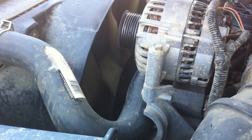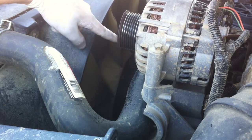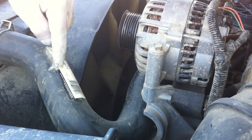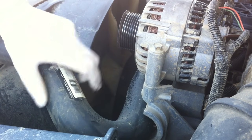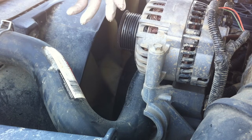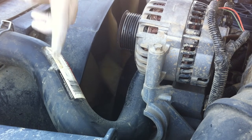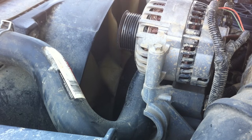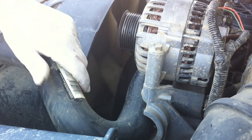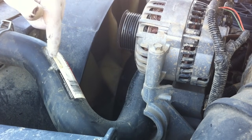On most 7.3s, the upper radiator hose is routed through the serpentine belt — instead of going around, it goes straight across. The only exception is the dual alternator 7.3s where it does have a go-around hose. This is also a great thing to do while you're doing this whole procedure, because this way you don't have to remove this hose in order to change the serpentine belt. Without this hose you will have to remove it and lose a little bit of coolant just to change the belt. So it's a great time to swap this out and get this design in — it's much better, about $20. Go ahead and take the belt off now.